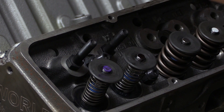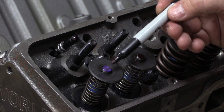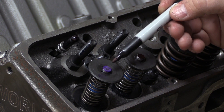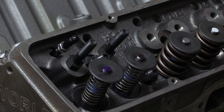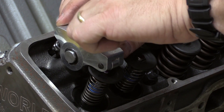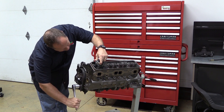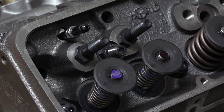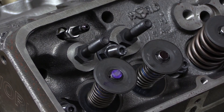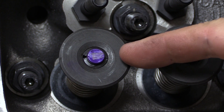To lengthen the pushrod, with my adjustable pushrod I just spin it out a little bit and drop it back into place. Generally speaking, if you want to move the mark down or lower on the valve stem tip you lengthen the pushrod; if you want to move it higher you shorten the pushrod. Clean the mark off, try it again. Now you can see the line the rocker has printed on the valve stem tip is a little bit clearer. The rocker line on the valve stem tip is just about centered up — if anything you want it a little bit higher than low as it rolls across, but this looks good. We're going to keep that.